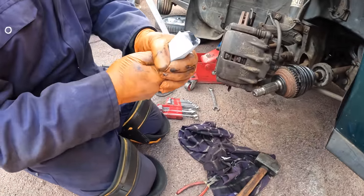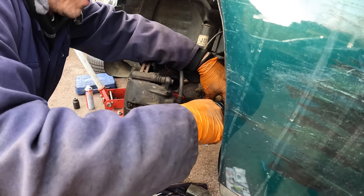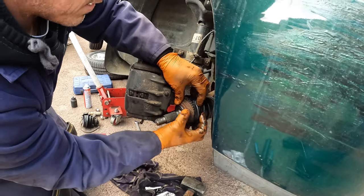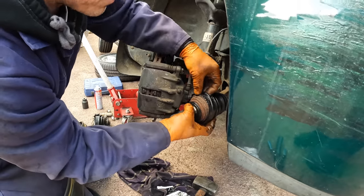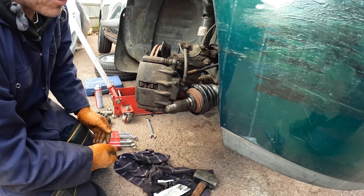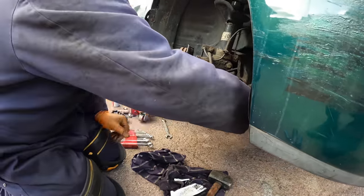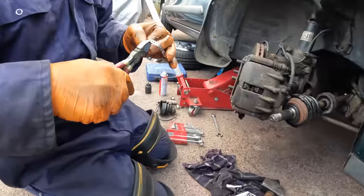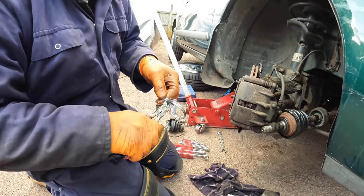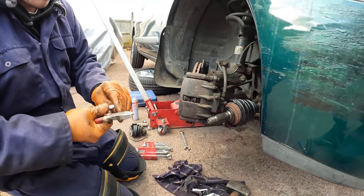The new boot goes on lovely. It'll be motoring happily for many moons to come. Chris explains you only need one of those grease envelopes — the CV wasn't bone dry inside, so there's already an amount of grease left in. If you're going to take the CV joint end off, pack grease in first before you put the joint back on the shaft and then pack the other end around it. You can also cut the boot down slightly to make it easier to fit if it's only a little too long.